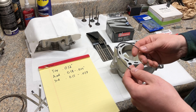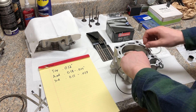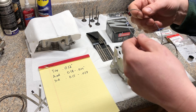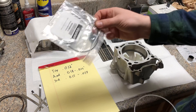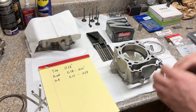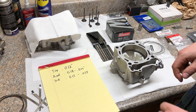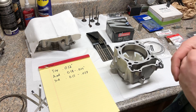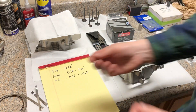What disappointed me the most was that you actually had to manually get your fingers in there to expand the oil scraper ring just to check the gap because it was so limp. It does rely on this spring right here to locate it, but anyway just a small observation — it won't cause any problems. I've done so many pistons and cylinders that I've just seen a lot of different things. I'm measuring them with these feeler gauges I have here.